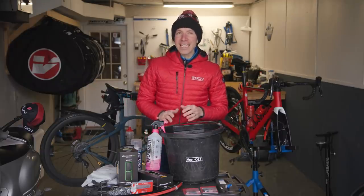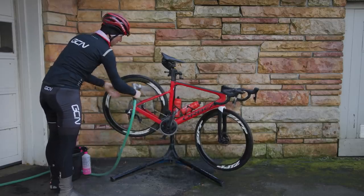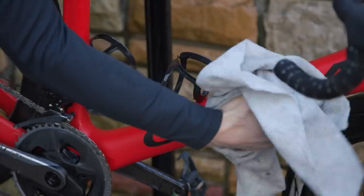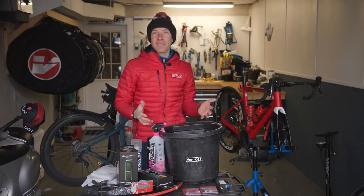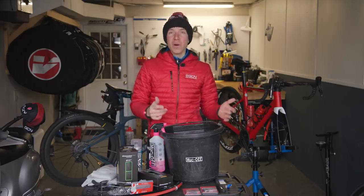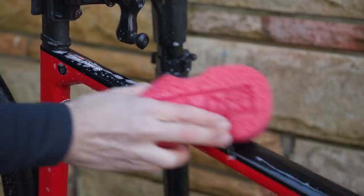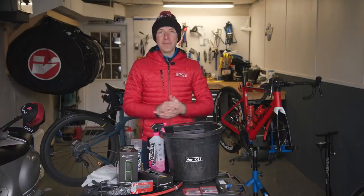One tip I always do is leave my cleaning kit outside the garage door with the hose set up ready to go. When I come back from a ride, I do a quick once-over with the hose, spray off all the muck and grime, then hit the bike with something like this Muc-Off cleaner, wipe everything down to make sure it's dry, and put some lube on the chain so it's ready for the next day. You don't have to meticulously clean the bike after every single winter ride — I'd say do a thorough deep clean with proper degreasing of all components about once per week to keep the bike going all winter long.